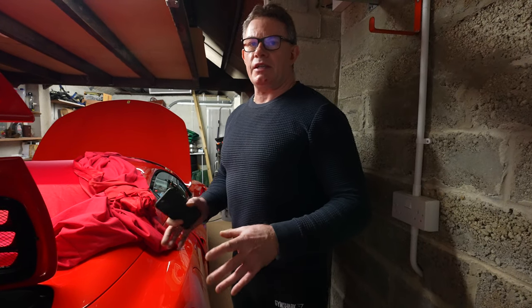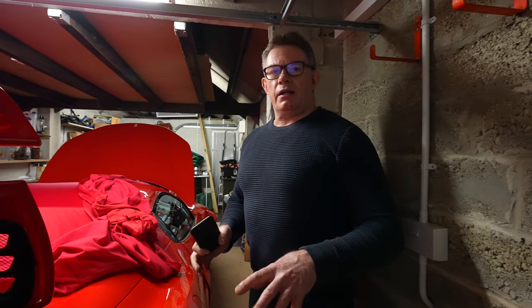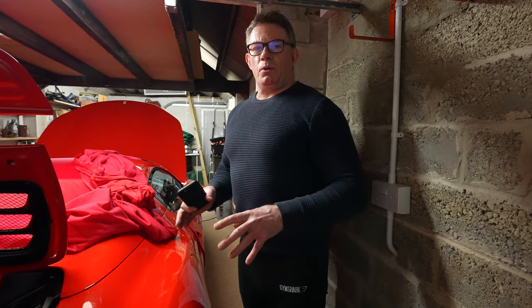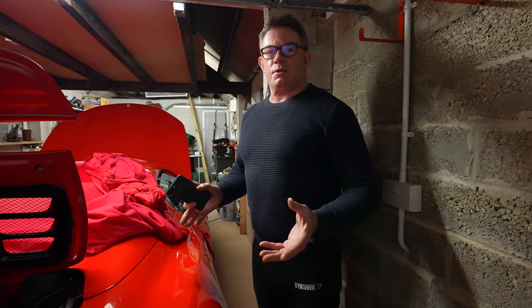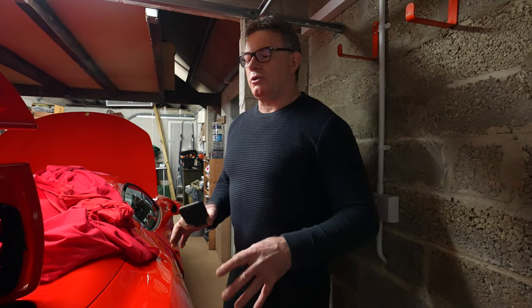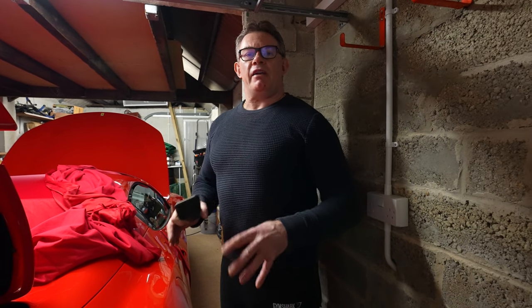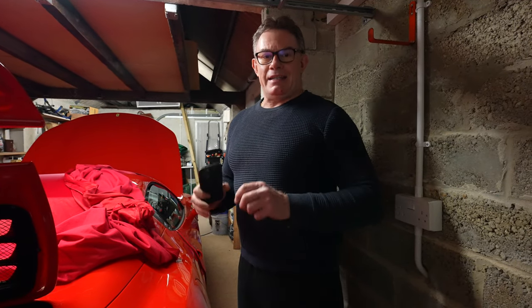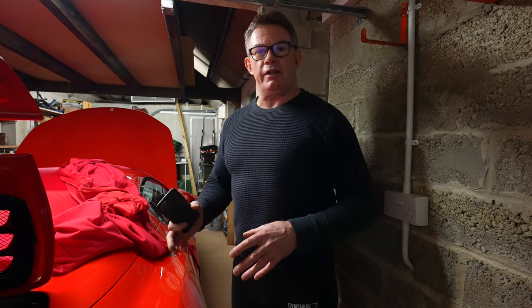The reason I'm doing this without starting the car: I suspect 90% of you would start the car to move it backwards and forwards. But the most amount of wear on a car, especially a performance car, occurs on startup. If you start a car and don't get it up to proper operating temperature by actually driving it, you introduce the most wear on the engine in a small period of time.